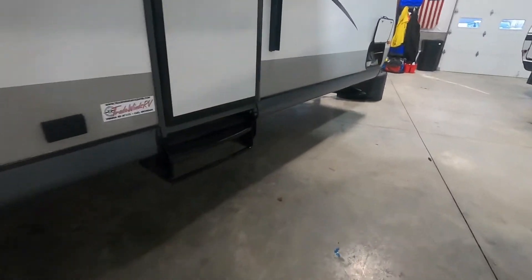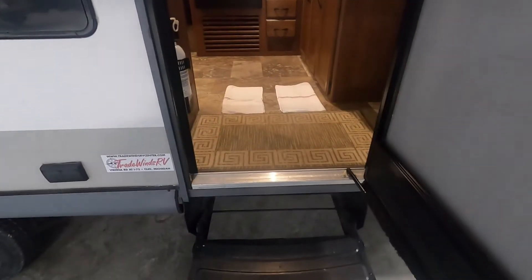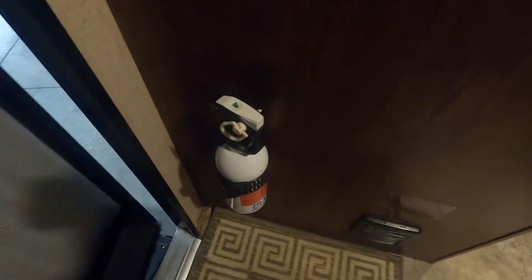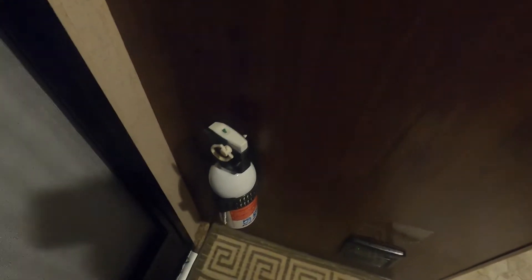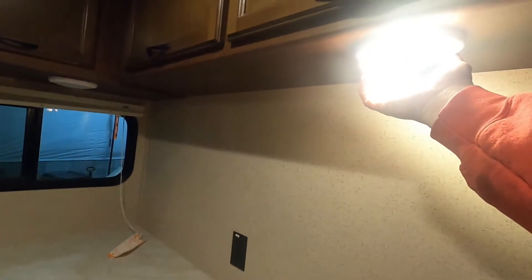I left your steps up so you can see how to bring these out. Simply grab here, pull towards you, and then flip them down. Coming up inside the unit, to the left immediately, I want you and everyone camping with you to know that the fire extinguisher is by the entry door in case of an emergency. Down below, on the floor to your left when you come in, is your 12-volt carbon monoxide detector. The reason I mention 12-volt: it's always running off your battery, so if you're going to be gone for the day, disconnect your battery to keep this from running it down.